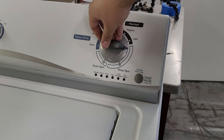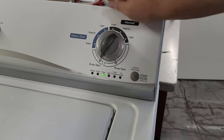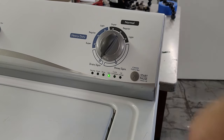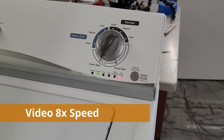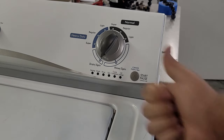The final thing I want to show you is the extremely important recalibration mode. Once in diagnostics, rotate the dial four times clockwise until the rinse light is displayed, then press the start button. This will physically reset all the major components on the washer plus initiate a quick test to verify. This is required every time you install a major new component such as a shift actuator, control board, lid lock, and so on — it ensures the washer will adopt and utilize every new part properly. In this case the recalibration took about two minutes and thirty seconds, though it could be longer or shorter depending on your machine. Once done, the machine will turn all the lights off and you are ready to use your recalibrated washer.